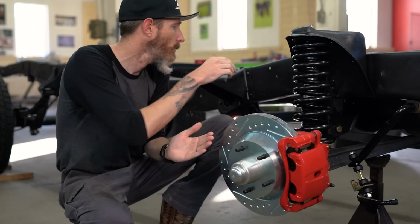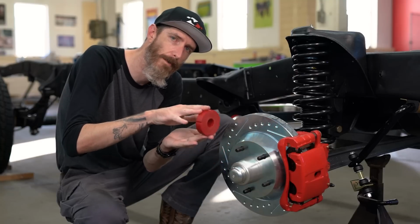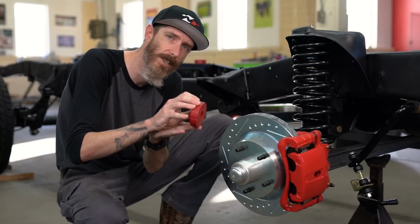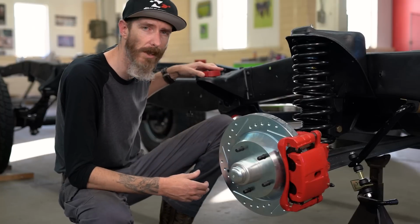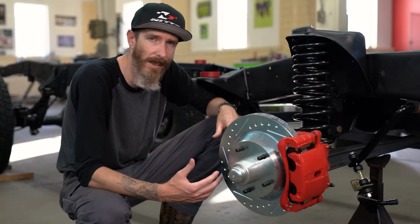Modern suspensions use two control arms that, as the wheel goes through its travel up and down, are able to keep that wheel straight and maintain that position. This truck just can't do it. I mean, no I-beam suspension can. So everyone complains about that aspect of the handling.